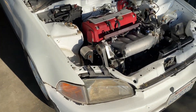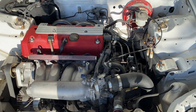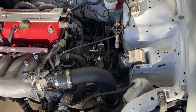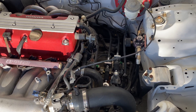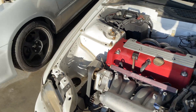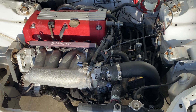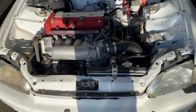Now when it comes to the K20Z1, it's a little different. These have a bit more horsepower — 210 horsepower — because they come with the Type R cam. The gear ratio is 4.7, so it's a lot quicker. The transmission gears go through a lot faster compared to the A2 — kind of like comparing a GSR to a B16 in the B-series world. So definitely a quicker ratio.